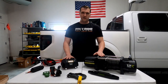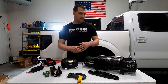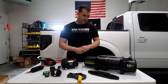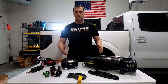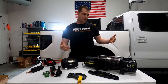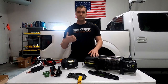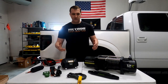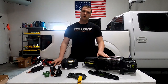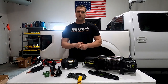I do want to go over my plan with this. I plan on building a winch cradle for it — I think I can make it cheaper than some models online. I also have a unique situation with my custom-made front bumper. By building the cradle myself, I can make the winch usable at both the front and rear of the truck, which is a really valuable feature. I plan on storing it in the bed with a 2-inch square tube made to go in a hitch receiver, and putting it on my bed rack to keep the weight towards the rear. With it being removable, I plan on running Anderson connectors at both the front and rear.